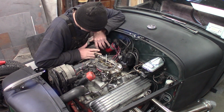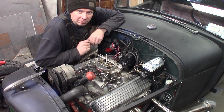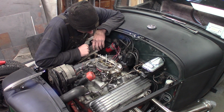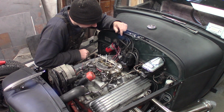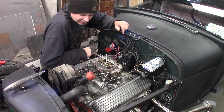I mean, this thing has got about 19,000 miles on it. It's 15 years old. It just could have failed here because it's an electronic component that sat around not being used for a long time. So, I've done all the checking I can do with what I've got to work with. So I'm going to bet that that module is bad. So I think I'll have to order another one. They're like 80 bucks, and put it in here, and hopefully that'll fix it.